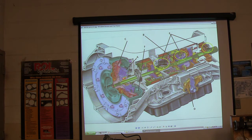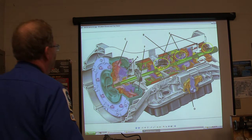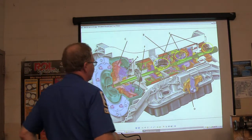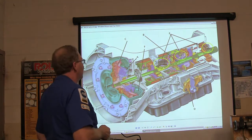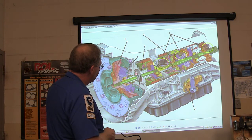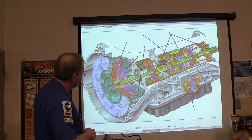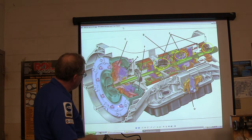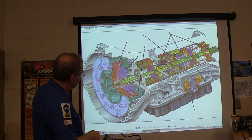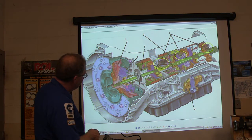That's the pump. This particular part right here is your pump — you're going to learn more about that. Now, the purple part in between is called the impeller, because it's hooked to the engine. It's going to throw the fluid against the turbine. That's how it works: whenever you're in drive, sitting with your foot on the brake, you're basically not putting enough pressure against that turbine for it to try to pull off.